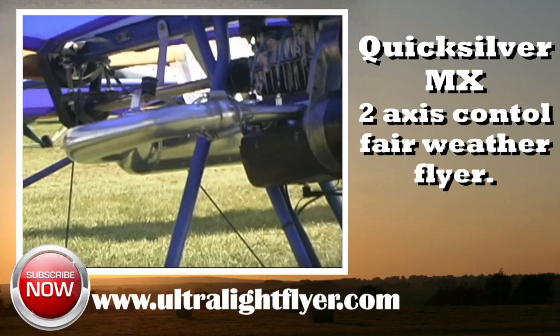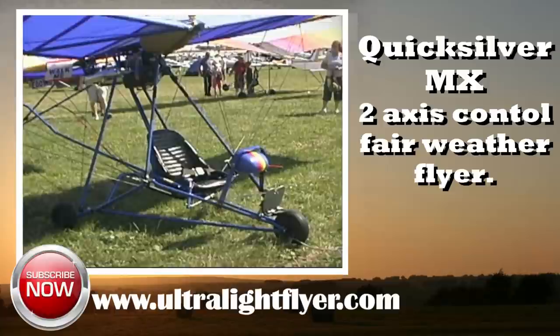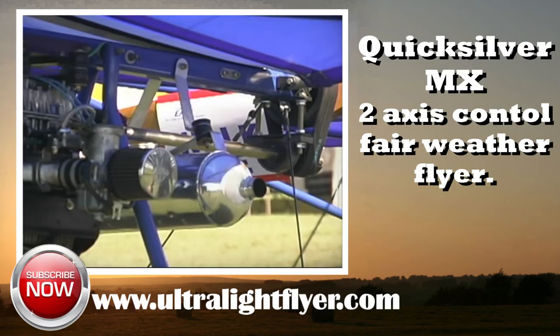One of the unique features of the Quicksilver MX is that the pilot can deploy both spoilerons at the same time by depressing the rudder pedals. This kills the lift on the wings and allows the aircraft to get into very short runways. At the time of production, the Quicksilver MX was the market leader for ultralight aircraft, and the Quicksilver line of aircraft still leads the world in ultralight aircraft style kits today.